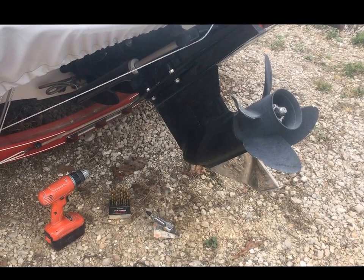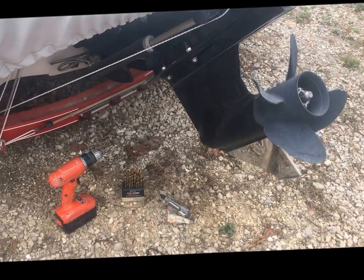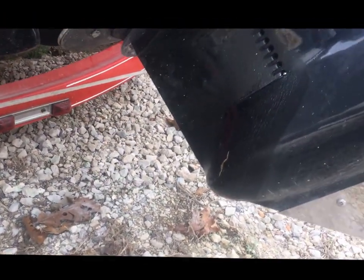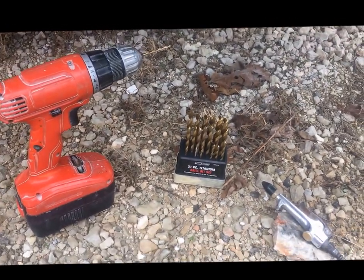It's Brandon from Heartland. Today we're going to be learning how to clean out the speedometer for an Alpha Drive, Bravo 3, Bravo 1, and a lot of outboards — most anything that has the water pickup on the front of the out drive. Especially this time of year when we've had a lot of rain, it's just a little hole in the tip of the out drive right there. Do you see the notch? That'll get clogged up.